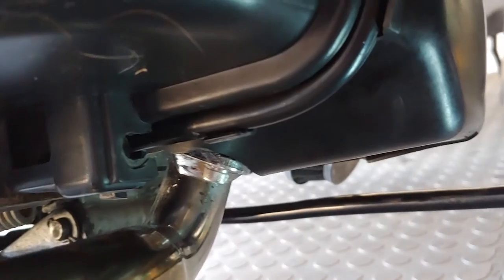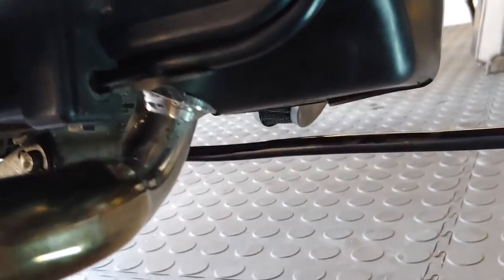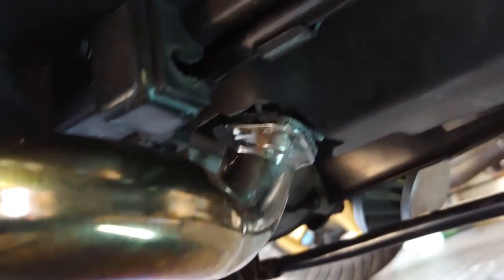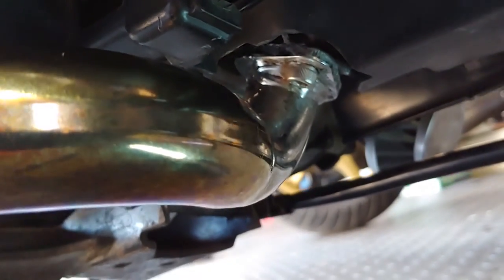What a monumental faff — that 90-degree bend. You can see it there. What a mission to get that in. I'd trimmed an Allen key to get in there. A word of advice: replace these bolts with stainless bolts — the factory bolts are made of the softest cheese known to every Frenchman.